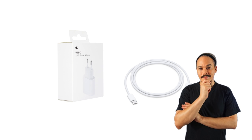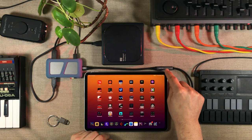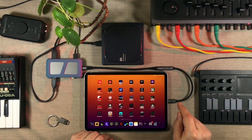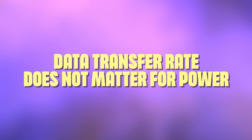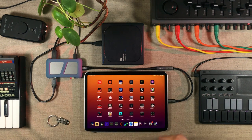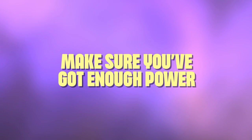When you buy an iPad, you usually get a charger and a cable with it — though in some countries they only supply a cable. Either way, the PD port is where you connect your charger. The cable Apple supplies is usually rated to 500 megabits per second, so if you were to use that for the data side of the hub between the hub and the iPad, you wouldn't be able to get the highest speeds out of the USB 3 ports. But if you're just using it for charging and power, the data transfer rate doesn't matter. One thing that does matter: if you intend to connect a lot of external gear like hard drives and MIDI controllers with lots of lights, those need a lot of power too, so make sure your wall adapter and cable have a high enough wattage rating to supply power to everything, including charging your iPad.